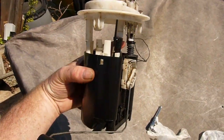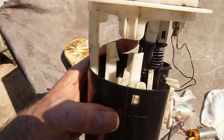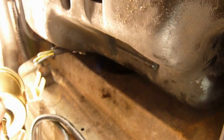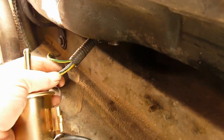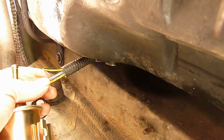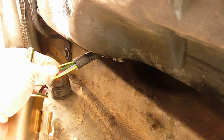I've assembled the pump. As you can see, the pipe is fitted inside and it's level with the bottom. Underneath the Picasso, next to the tank, this is the wiring and we'll be using the two thicker wires. The green and yellow is the earth. In this case the blue, which was from the tank, is the positive. The two thinner wires are the sender wires for the fuel gauge.